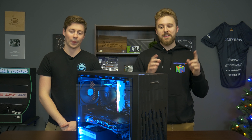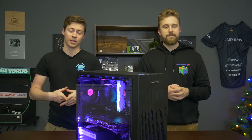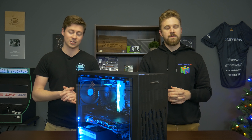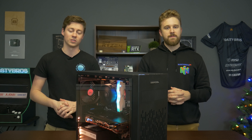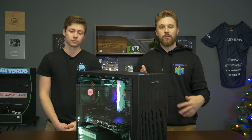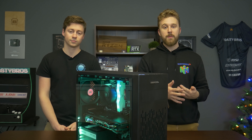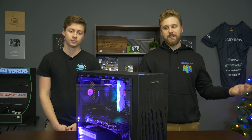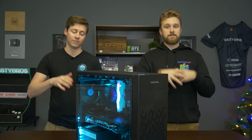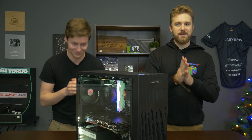All right guys, as you can tell from the benchmarks this PC performed pretty well. The Athlon actually held its own in most games we tested with the RX 580, and really the next best upgrade we recommend is just a better CPU. You can go first, second, or even third gen — something as simple as a 3400G or even a 3600 if you want to go all out. Simple upgrades, cheap to do, and you'll probably get double or triple the performance for a very small cost. If you're looking to build this outright right now, it might be better to go with a Ryzen 3 2200G or even a 1200 to start. But if you already have this system as a $250 PC and followed our guide and you're looking to upgrade it, go ahead and do this — you can get good performance now and then upgrade the CPU later. As always, don't forget to use the links down below to build this, as those parts do help us out, and don't forget to like, comment, and subscribe. We'll see you guys in the next one!